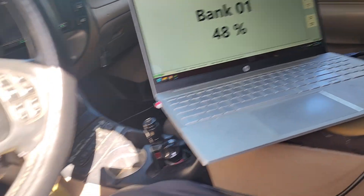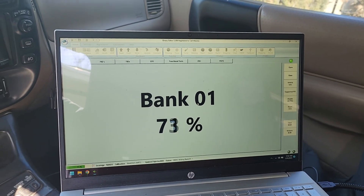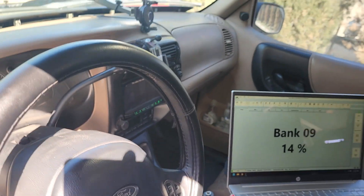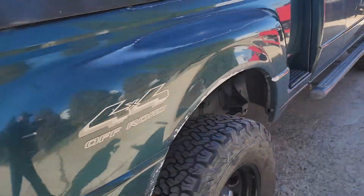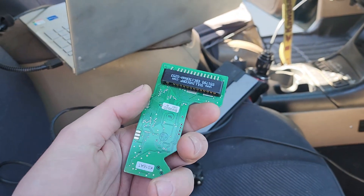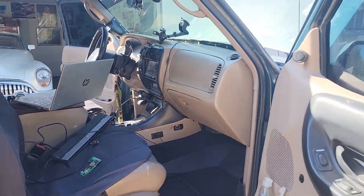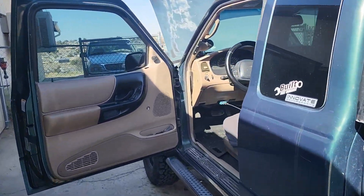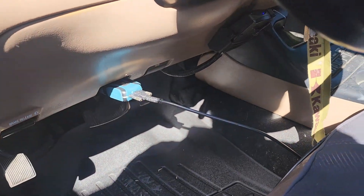Here we go — got the Mongoose plugged in, binary editor. I was able to read my factory tune out of the computer and update the injector size, hopefully I did it right. I also got some new tail lights, put those on. I believe what happened was my Quarter Horse died because it was shutting off and dying on me quite a bit over the course of a couple of days. I left the truck parked for three months, came back to drive it, and it tries to stall and the computer resets like 15 times within 10 minutes — so that's unacceptable, that's one of the reasons why I'm doing this.